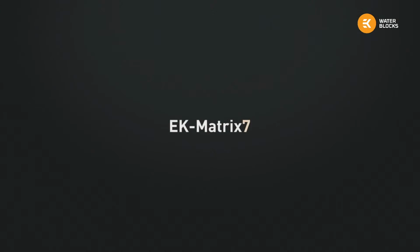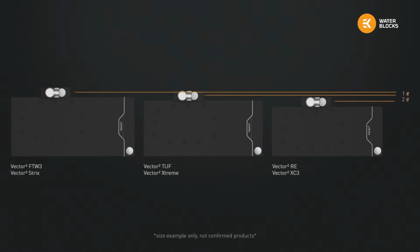That means that a torque fitting, an extender that exists or an offset that already exists will be able to make up the difference, and you could have any of the radiators with any distro plate. So that's why we've been obsessing with 7, and you can see a difference in 7mm on every product. So the ones which you see right now are the extenders and the offset fittings in 7, 14 and 28. The same goes now for the radiators, that they're 30, 44 and 58mm thick.